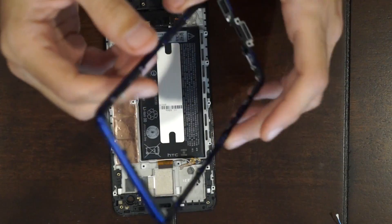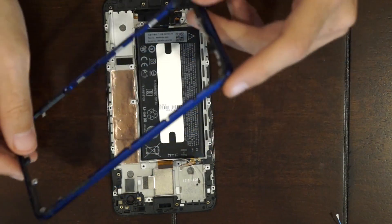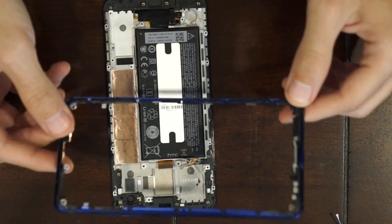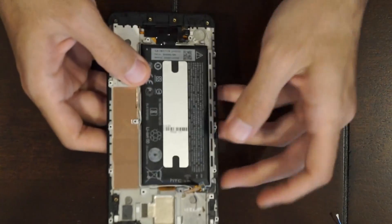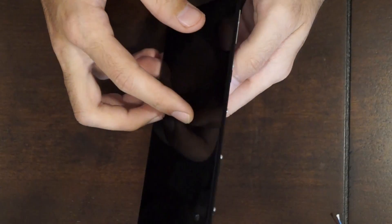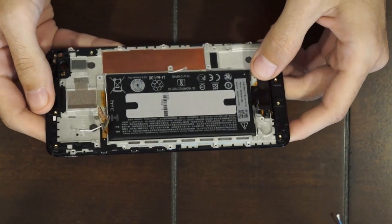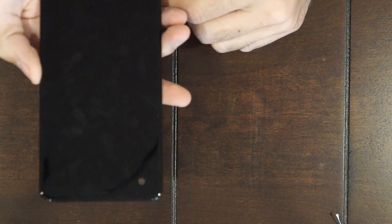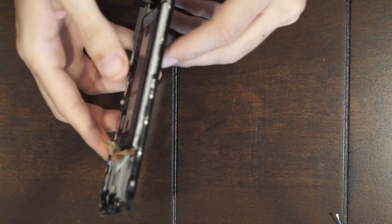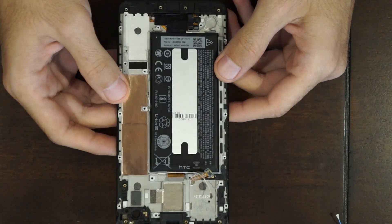The cool thing about this is you'd be able to possibly paint it a different color if you'd like, for people who want to customize their phones, or easily replace it if you have any scratches or damage to the mid-frame. You're left with only the LCD assembly and the battery. Honestly, HTC has really improved on their build process on these phones — these are now much more easily replaceable and repairable. You don't have to spend an hour taking the phone apart, so I'm really impressed. All prior HTC phones I ever worked on were just a real big headache to take apart with cables all over the place. So I give it a thumbs up on this one.